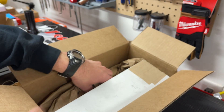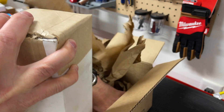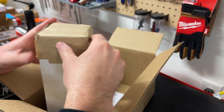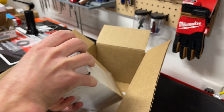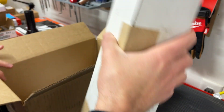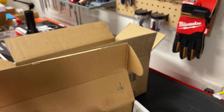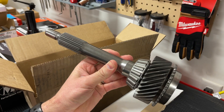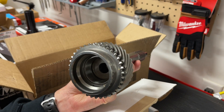Anyway, here's the white box it came in. If you look at review pictures and unboxing videos from other people, it seems like it's all the same white box. The shaft looks identical and it already has the bearing installed. The Tremec distributor I was ordering from showed it not installed, because that's how it used to come from Tremec — you would have to have the bearing pressed on and have a shim under it. In the end, my opinion is that these are all the same shaft no matter where you order them from. Whether it's Lethal Performance, Late Model Restoration, or D&D, all of them come in the same box and look identical.